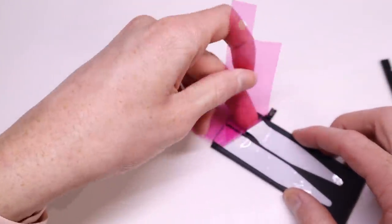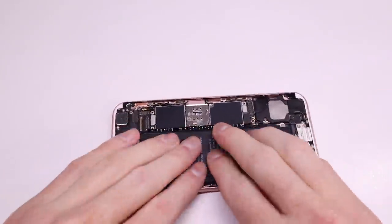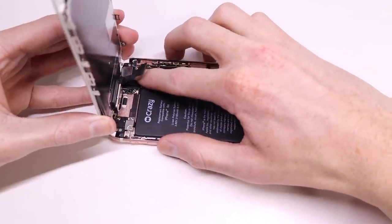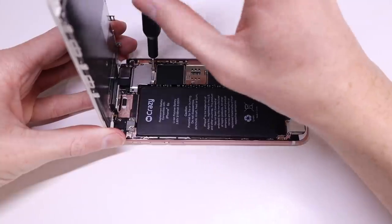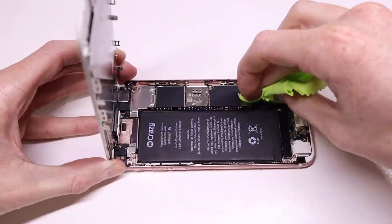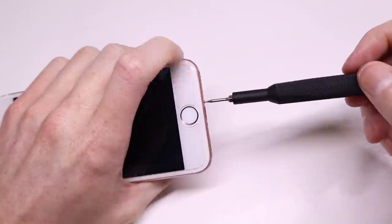Next I can install the new battery by applying the new battery adhesive tabs, using a spudger to make sure it's adhering down to the back of the battery properly, which makes the removal of the plastic film much easier. With that done I can lay the battery in, making sure it's connecting properly. Now that I know it's positioned correctly I can disconnect the battery yet again — it's important to leave the battery disconnected in this process so you don't short out the phone. With that done and the appropriate brackets and screws reinstalled, I can seal back down the device by installing the display and the two pentalobe screws at the bottom.